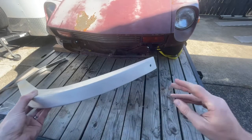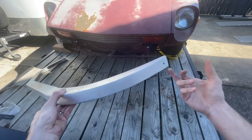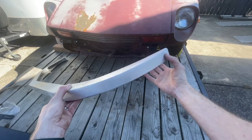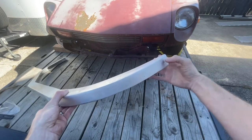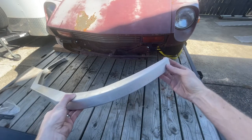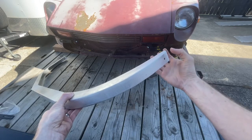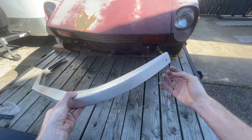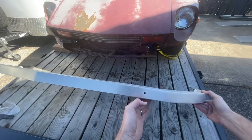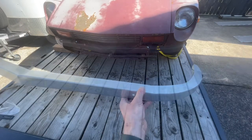And then also, we've added a hole here on the corner, again, to make it easy to install. So when you wrap that around the headlight bucket and pop that in, you'll have a long bolt that goes through here and a nut and a washer that comes on the backside. In addition to that, we're going to have some rubber spacers here that'll allow you to tighten and have a little bit of actual side adjustment in here. So we'll show you that as we get a little closer, but that gives you a general idea of what we have to work with here.